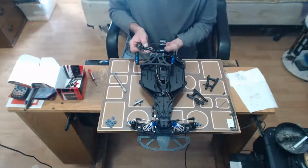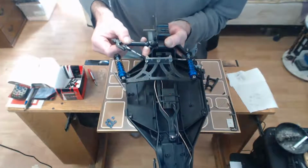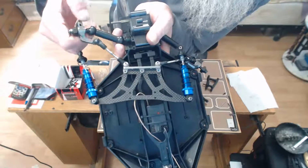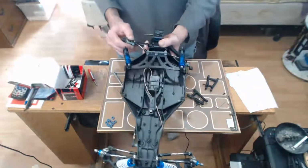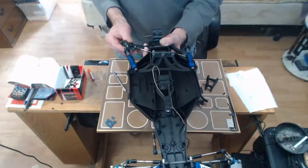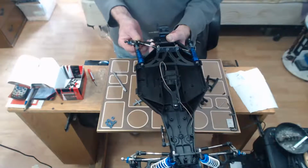It's hard for you to see, but to give you an example, you can see the pin right here at the top of my finger, maybe. Let me try to get there. See that pin right there? And this pin on this one isn't in the same spot. It's just off a slight bit, not quite in phase. So spin it 180 degrees. Well, that one's even worse. Make sure you got them almost lined up right.